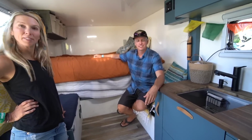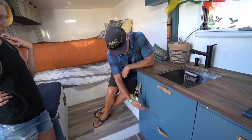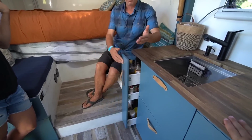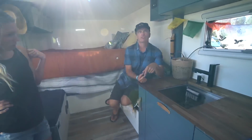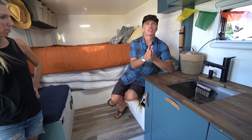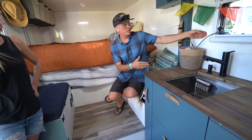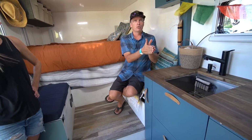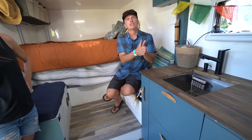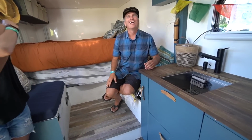But that's great. Talk to me about these electronic locks. So basically, behind each drawer is a little puck, and it's a magnet that, when charged with 12 volts, magnetizes and then attracts another plate that's on the back of the drawer. So I have a little puck mounted to the wall in the back of the drawer, and as soon as I turn the ignition on, it powers these magnets and locks it all up. How the heck did you wire that up? Oh, it's just wiring, man.